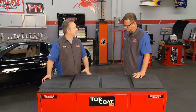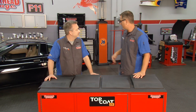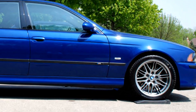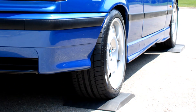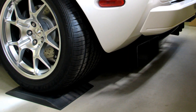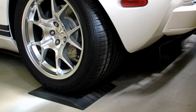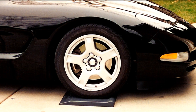It's not just for situations like mine. If you have a fun car like this, chances are it's sporty — probably not your daily driver. You take it out on the weekend, or if you live up north, you're only going to drive it in the summertime, so it's going to sit all winter. That means flat spots, especially for a performance car. The newer cars with 18, 19, 20, 24-inch rims have a smaller and smaller sidewall. The tires are getting wider — this one is 15 inches wide, about a 345-millimeter tire. With smaller sidewalls, they deflect less, so deformation transfers to the tread instead of the sidewall. Wider tires also pick up road temperature more, causing flat spots more easily. And sportier cars have a softer compound that's grippier but much more susceptible to flat spots.